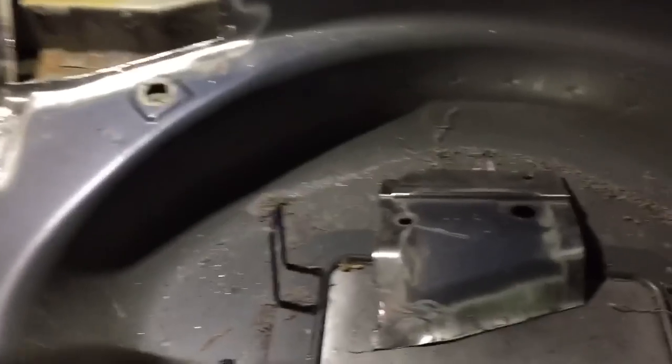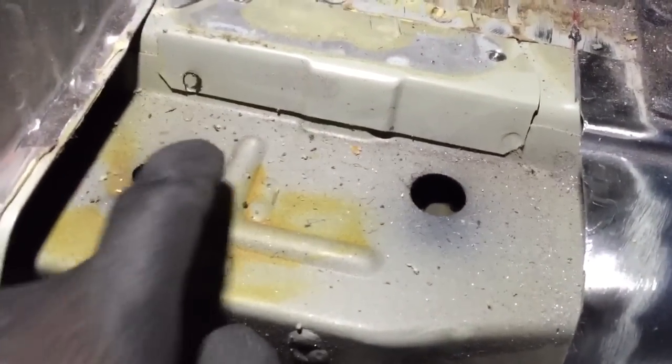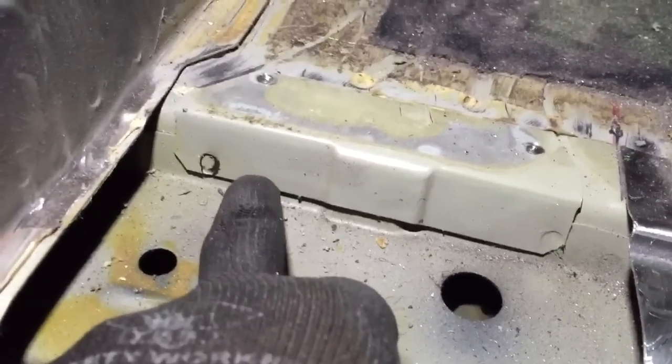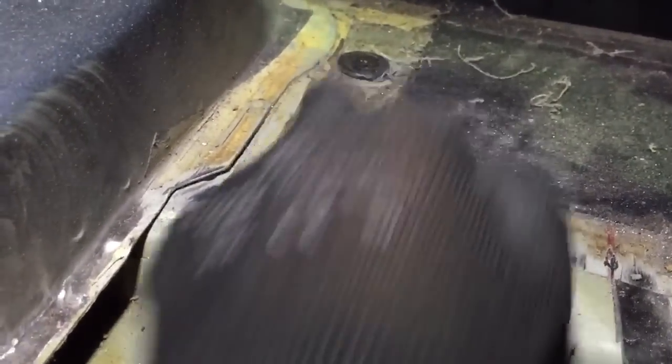So we've cut the left rear open, we'll pick this panel because we can reuse that. And that's a look inside the cavity. These 3 MIG welds at the top and the T-piece are all fine. Definitely worthwhile taking this cover off because there's a spot weld there that we'd never be able to get to. This panel is broken. That one's good, that one's broken. You can also see the gap in this corner up here now compared to further up the panel where this rear axle carrier panel is dropping slightly.